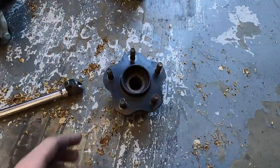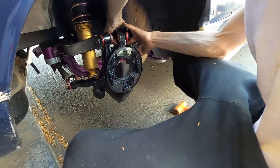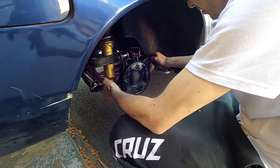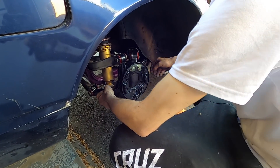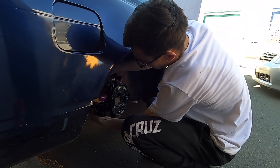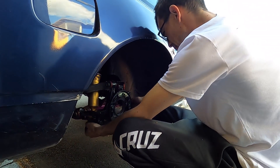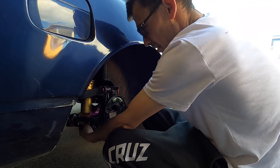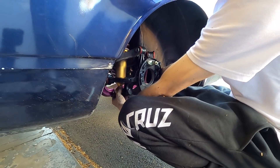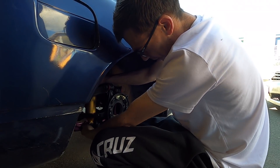The studs are all pulled through on the old hub - just getting the knuckle in now. It looks so much better than the old one. So much better, it looks so nice. It's got all the new lower arm stuff. You're gonna be running a full TSD kit right? Yeah - lower arms, toe, traction. Just gotta wait till mid-December till they've got stuff back in stock. At least the knuckle alone is gonna make it look fucking way better. Dropping all the handbrake stuff off on Monday to the zinc platers.